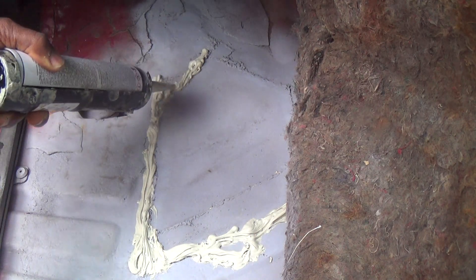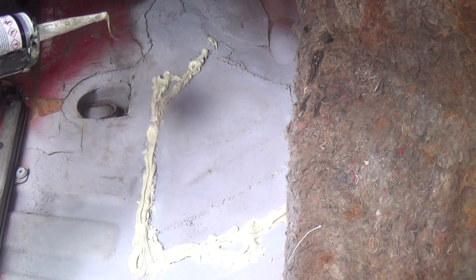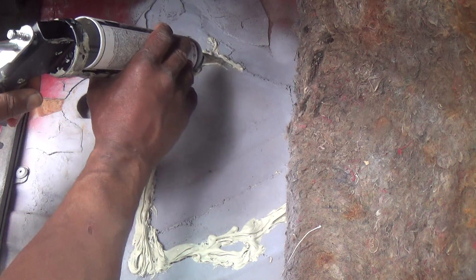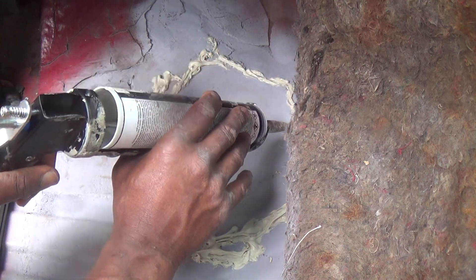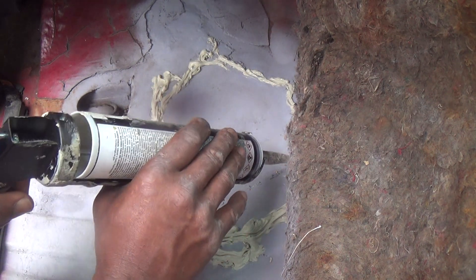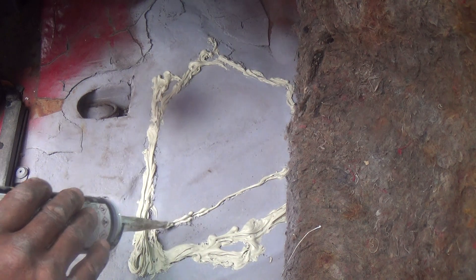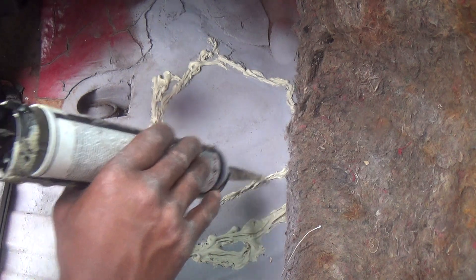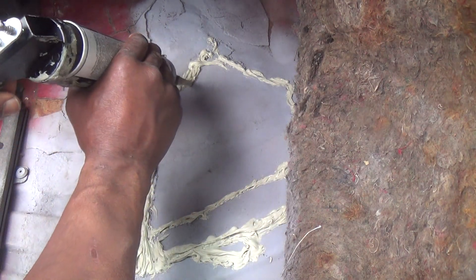Very confident I will not have Barney Rubble-style Flintstone feet going through the floorboard. You guys can do this type of work — just be prepared. Because this floorboard had some rust, you might have to take out a bit of the floorboard to get at it. But using that button-cut technique of laying metal over the rusted hole and then cutting in the metal — which is in itself a template — you're gonna save on material and you can leave good metal in there, and the old metal will just fall right out.